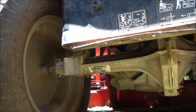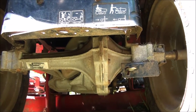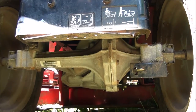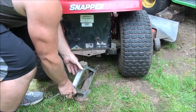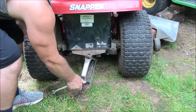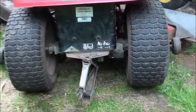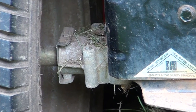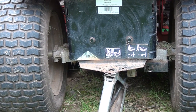I'm going to have to get this transmission out of here and try to do it the quickest, easiest way possible. Looks like I need to get a half-inch, possibly a nine-sixteenths, a couple set of wrenches. I'll jack this thing up. I have it jacked up — I'm going to start on this side here. There are four half-inch bolts, two on each side, that you need to remove. That's the first thing I'm going to do — well, second thing; jacking it up was the first.